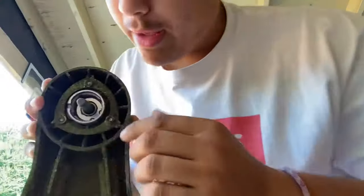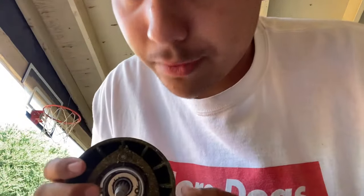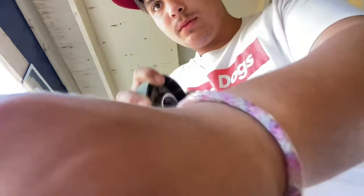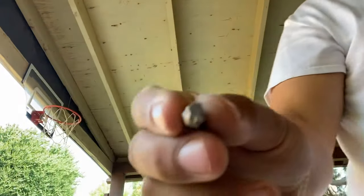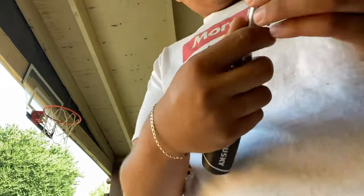You have the gear right here, and then you have three screws — these are the funky looking screws that look like stars. If you don't have one you're going to have to buy that. If not, just put the gear back and screw the head on. But if you do have the screw you can actually take the guard off. You're going to need a T27 — that's how the head looks, it's one of the stars. If you go to Home Depot you can get this as a drill bit or a screwdriver. That's what you're going to want — it fits right into the three little bolts.